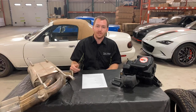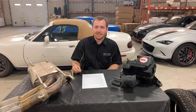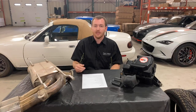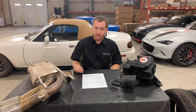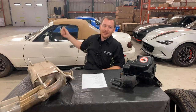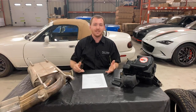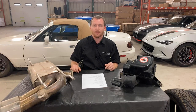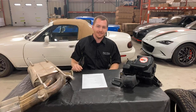If you have an old car that's 15, 20, 25 years old, a lot of times you'll be dealing with a soft top that's not quite fresh. It's probably got a few holes in it, or it's starting to get worn down to where you may have some tears in the window. When you're driving throughout the winter, that's only going to get worse. If you have a plastic rear window in your Miata and you've got a bunch of snow on the window, don't reach back there and bang your window — if it's an old plastic window, it'll probably crack. Be very gentle with your top, especially if you have an older car, because the cold temperatures may cause it to crack. Brush it off from the outside gently. Don't smack it from the inside, because you'll probably create more problems for yourself.